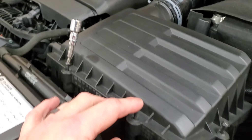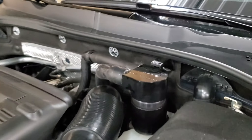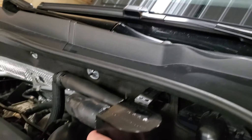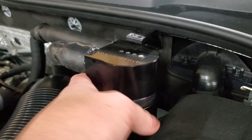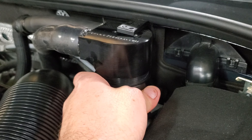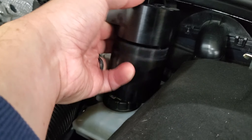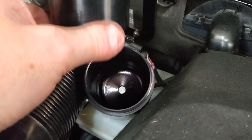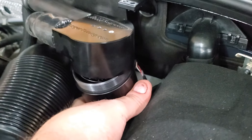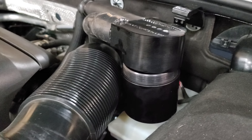While the car is draining I thought I'd take a minute. I wanted to go ahead and look at the air box and see what the filter looked like — curious to see if it was stock or modified. I also wanted to check the oil catch can. In a previous video I mentioned the install, but the catch can won't clear the brake booster so you have to take it off to check it. I checked it — zero oil, zero water, nothing. If you're getting water in there, that moisture could potentially indicate a head gasket issue.